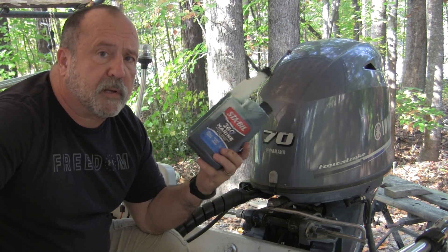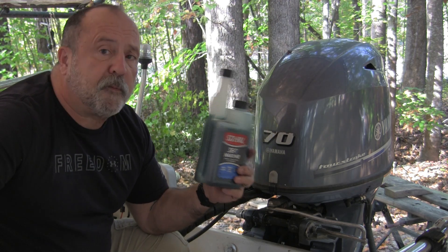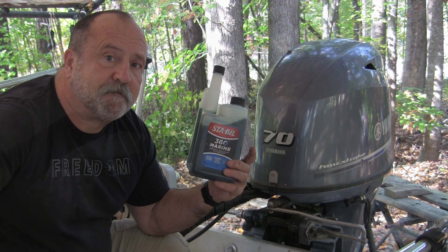I want to do a short video on winterizing your Yamaha outboard. It's important especially if you live in the northern climes. We're temperate but typically we don't use the boat in the winter unless we get some 80 degree days. I do like to go through the winterization process because there are a couple of things that are important in maintaining the engine. Go ahead and hit the subscribe button. Part of winterizing your outboard is putting a fuel stabilizer in it. I put this in after every fill, so I'm not going to do it right now because I know I've got a good percentage of this already in the fuel system. If you don't use this, I would recommend adding this to your fuel tank before you winterize your boat and running the engine long enough to get some of this into the engine.